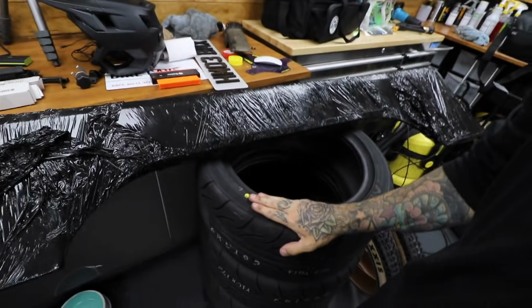The reason why I haven't got to the Polo yet is because I need to raise the coilovers on the front. I need an ST Suspensions C-spanner. I've got to raise the front suspension because right now the car has a slimmer profile tyre. These tyres are a bit bigger in profile, but I think they'd be great for track days and some street driving. So I need to send the Polo wheels off for a refurb and get them painted black. That should hopefully look really cool on these tyres as a little daily, jump-in street car.